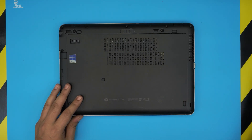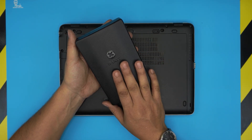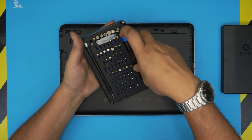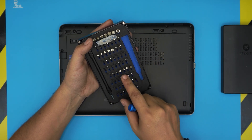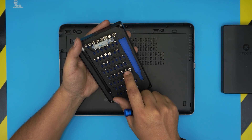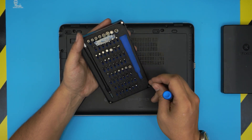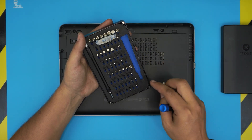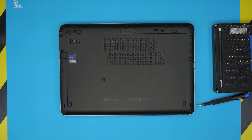To do the service, we're going to start by looking at the tools we'll be needing. The most important tool is the screwdriver set. I recommend the iFixit toolset — I'll leave the link in my description. These toolsets have all the bits you will need for electronics, including the Torx screw set which has a secure lock with a pin in the middle. You're going to be using a Phillips number one and a Torx.